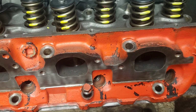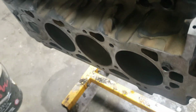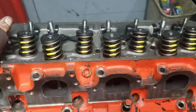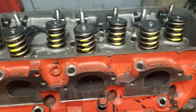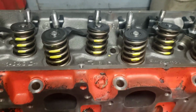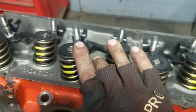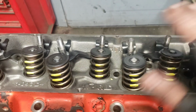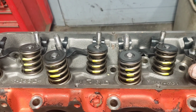And that'll be one side. And then we got the other side clean. All cleaned off, and the holes are all cleaned out. But before I set the gasket and head on, we'll give it one final clean and all that kind of good stuff. And there we go. And then we'll make sure, as we're doing this, we grab the torque specs and the torque procedure and follow that to a T. Make sure that head's going to be good and clamped down.